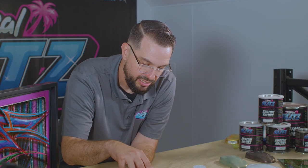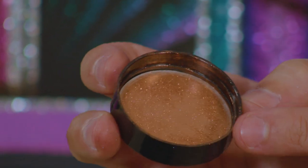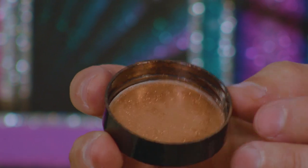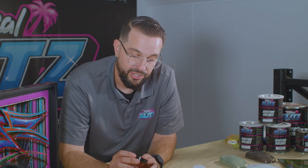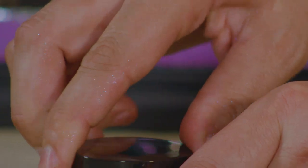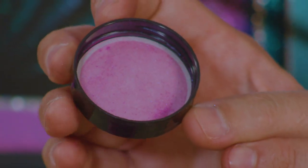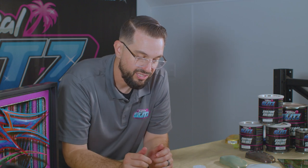Copper penny is a 60 micron but it's an aluminum-based pigment with no transparency — it's opaque and will actually cover up your project pretty well. You can add any of this stuff to your base coat. Certain colors require more, some go a long way with a little. If you're creative and want to think outside the box, document what you're doing so you can repeat that color again. Here's stuck in the 80s pink — look how fine that is, and look at the difference between these two. They're both 60 micron, which gives you an idea of how different pigment types vary in appearance.